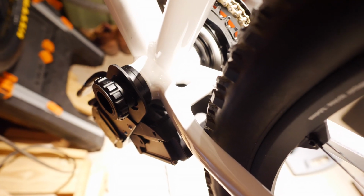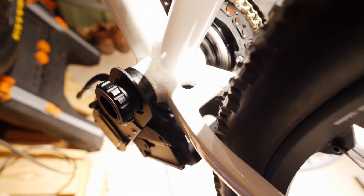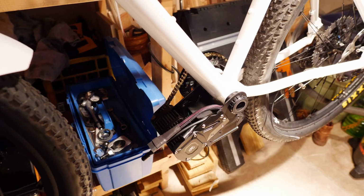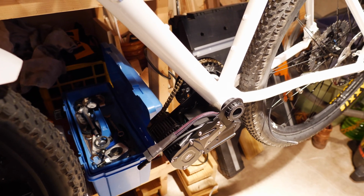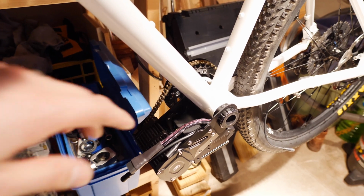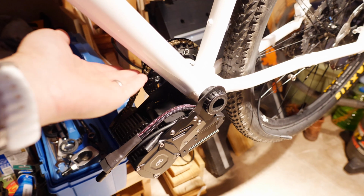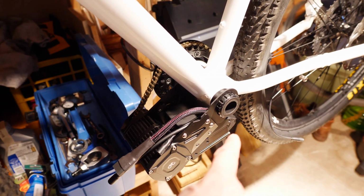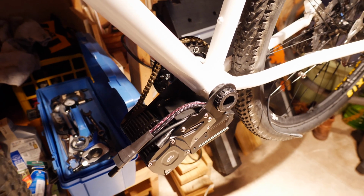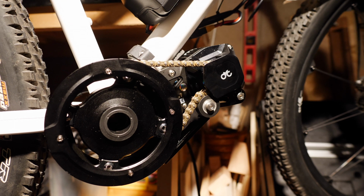So, you know, once I was able to auger out the bottom bracket shell, piece of cake to put this thing together. So importantly, I haven't tightened it all the way. You know, I'll see what the torque specs are for it, but that's because I want to install the bracket that keeps this thing from rotating under torque. That's going to hold it up underneath the underside, so I want to get that installed before I tighten this right on down.